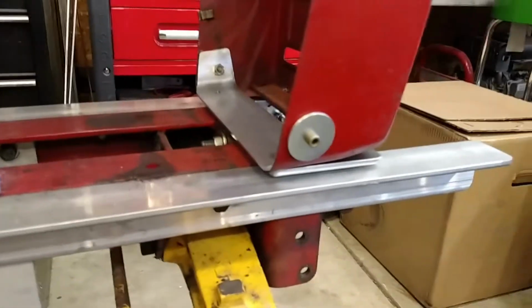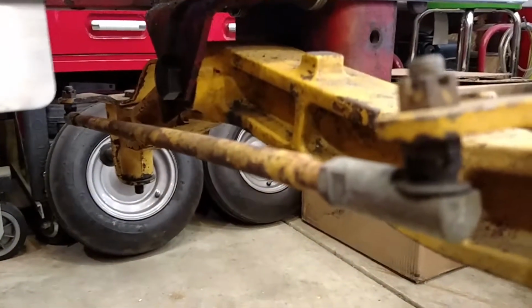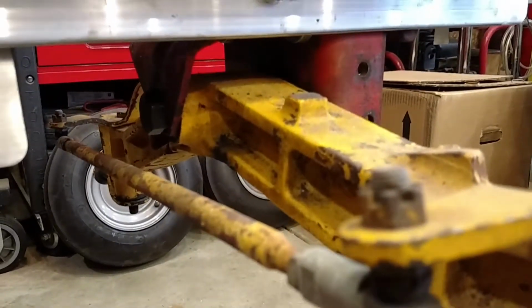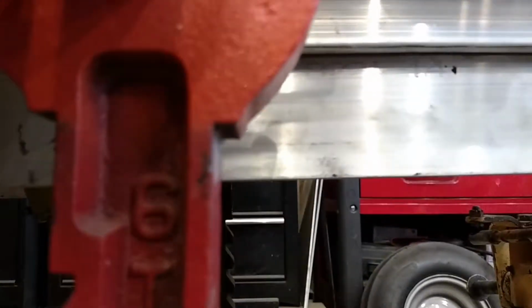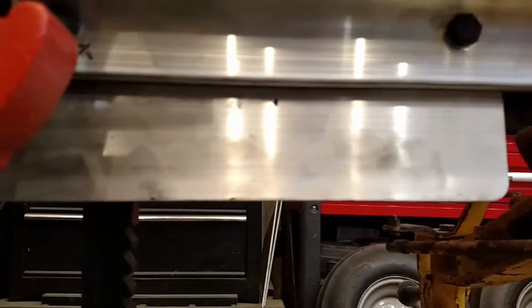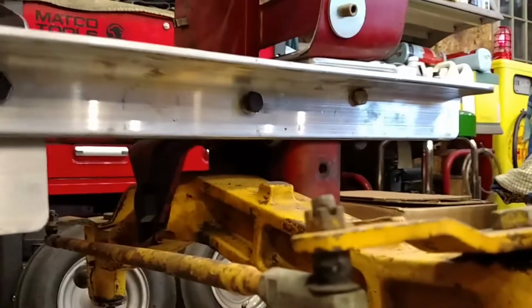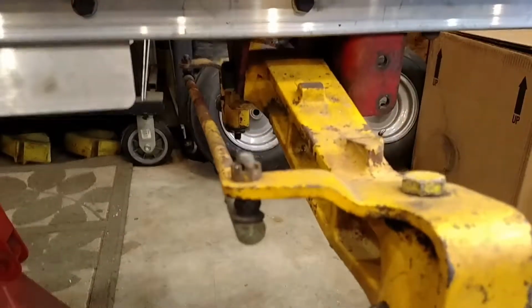Aluminum frame rails. And got a good Cub Cadet front end under her. Had to stretch the frame about a quarter inch. Full length aluminum plate underneath. These tractors had excellent engines and transmissions, but the rest of the tractors were just built very light. They were basically built out of sheet metal and angle iron, and that's just something I don't care for, so this tractor's going to be put together right.